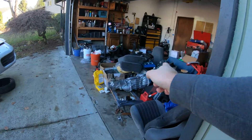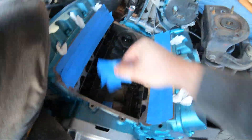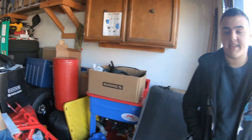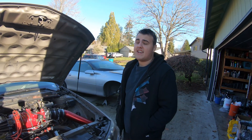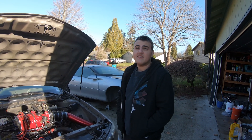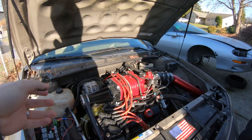When we put together Project F's motor, you can see right here, we just completely deleted it — it's not here. So we didn't have to worry about it and we didn't notice then either because why would we if it's not coming back in the engine? So this whole time, the balance shaft has been out of time — by about 130 degrees.